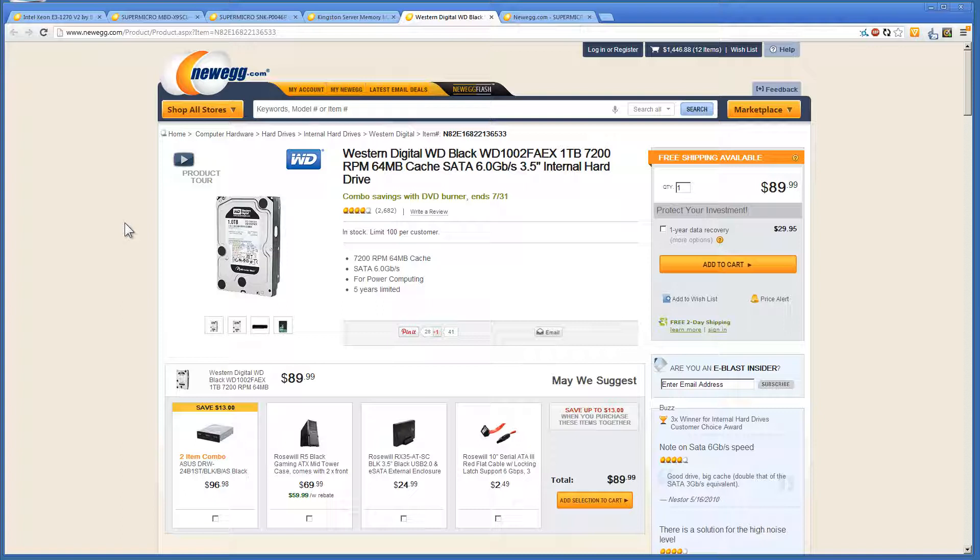In the case of what our client wants — simple web hosting at around a thousand dollars — we went with a higher chip for extra performance. You could go with an E3-1230 and save about a hundred dollars. But if you have the extra money, grab a dedicated RAID adapter with a battery backup for caching. Here we went with WD Blacks at one terabyte each, and the RAID 10 gives us about two terabytes, which is fine for web hosting.